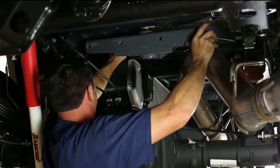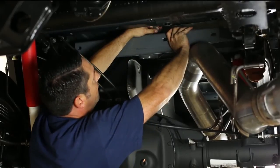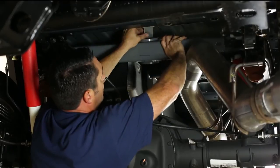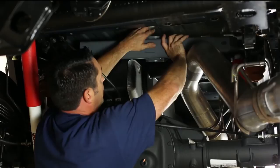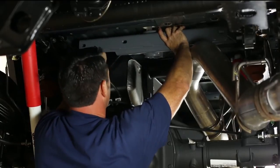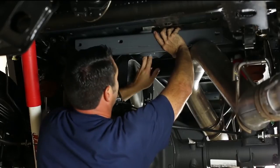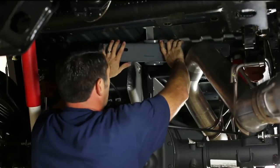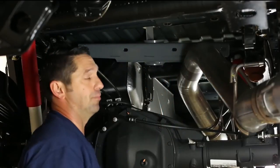Now we're going to lift the center section up above the fuel tank and put the hitch helper bracket down into the main receiver hole. Be sure it's oriented left and right, and once in position, engage the release pin. Verify it's gone through the slot inside the lifting device, then push it forward out of the way so we can get our rear cross member support in.